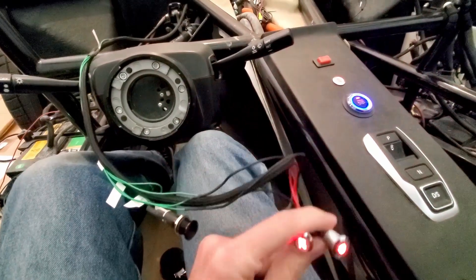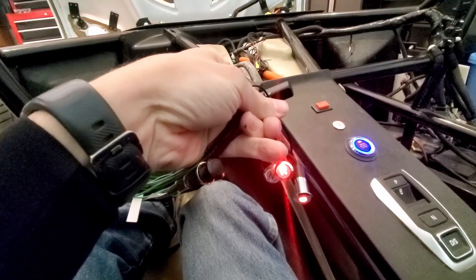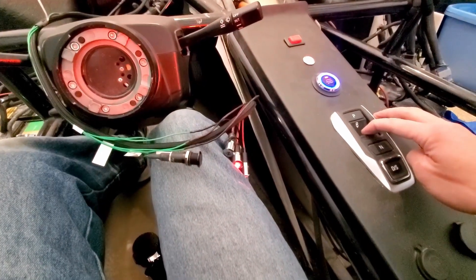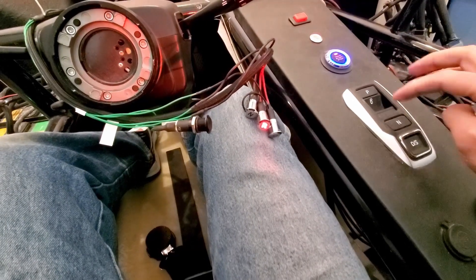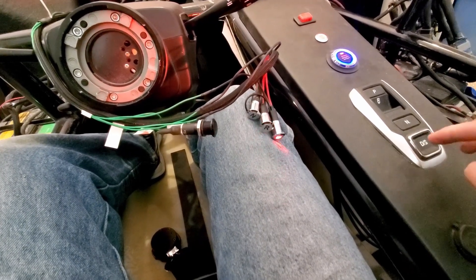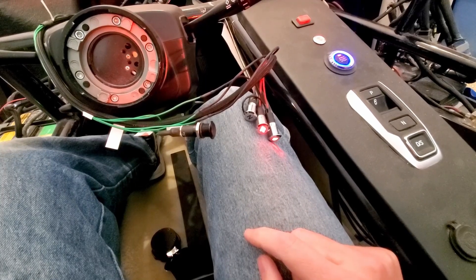Okay, interesting — it's like the opposite here. We've got drive and reverse lit up and neutral's not, when it's actually in neutral. When I go into reverse it does go to reverse, and drive goes to drive. I'll have to ask about that. I heard back from EV Controls on the output wires — apparently they default to a three-LED configuration with red and green, and when you turn on both red and green it makes yellow, so yellow would be neutral. It's just a firmware update to get it changed for my application. I think we're good.